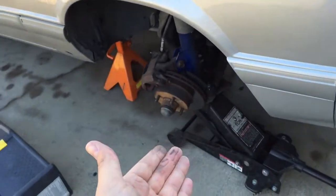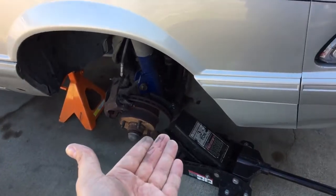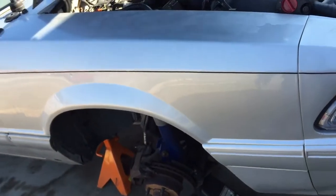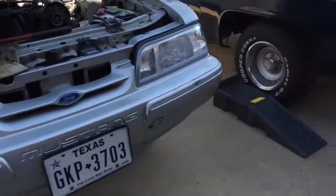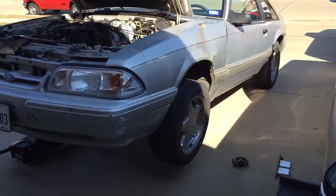The key thing is you don't have to take the shock off — just support the car with the jack stand, use the jack for spring pressure, swap it over, and you can literally get each side done in about 15 minutes. If you have any questions or comments let me know, I'll answer everything the best I can. Later guys.